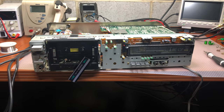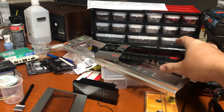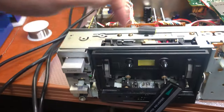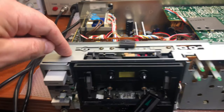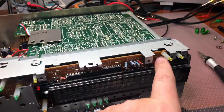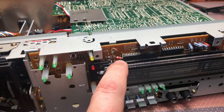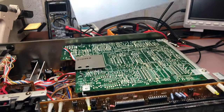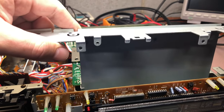So here I continue. I had to remove the front panel, then unclip the buttons panel with the glass — it just clicks in. Then I removed four screws holding the tape transport here and two at the bottom. Then we need to remove the top panel — it has three screws here, here, and here, and another three from the top. As you can see, this is a slightly improved version — this resistor was absent on the previous deck I had.